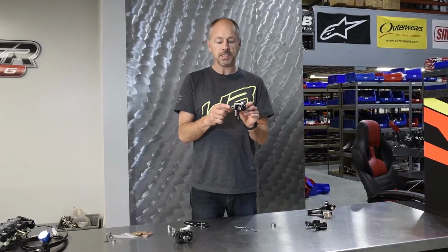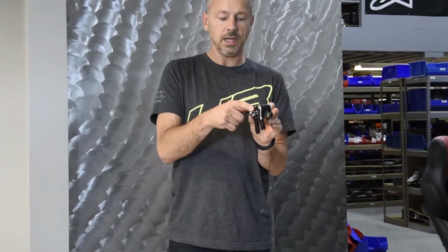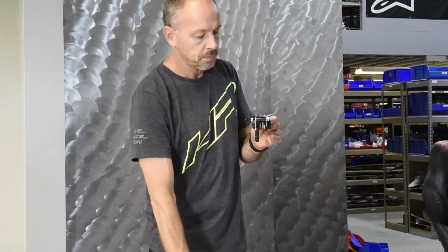It is a 2-piston caliper, so it has a piston on the back side and the front side. A real nice stainless steel piston. So now the pistons move in and out together. As the pads wear, the pistons compensate for it and just move in further and further. So you get full use of the pad as the pistons travel. No maintenance at all required.